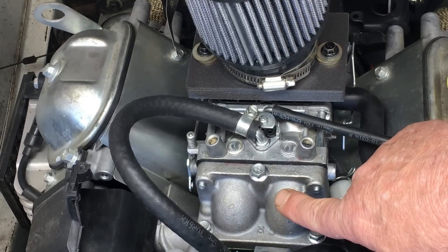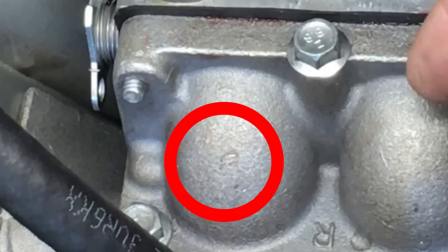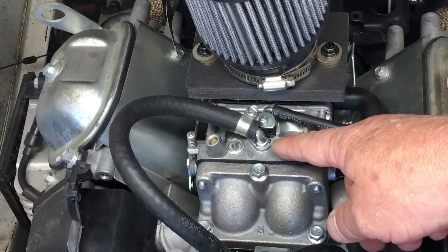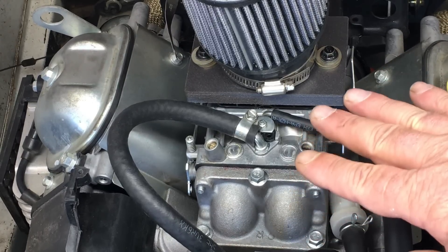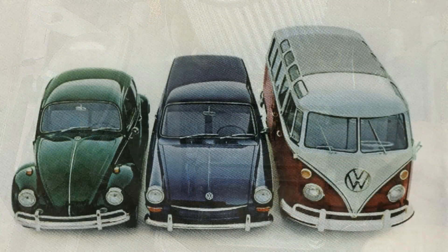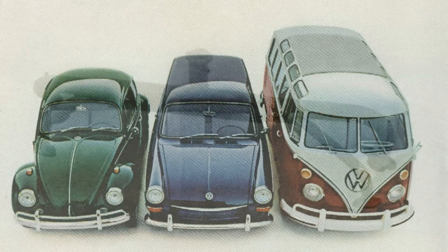One of the things I noticed about this carburetor setup is the upper intake manifold gets super cold when the engine is running. If we zoom in, we can actually see the remains of some condensation that formed on the manifold. The reason the upper intake manifold gets really cold is not a mystery at all — this is common with carburetors, and the short answer is it's due to the phase change when the gasoline goes from a liquid to a vapor. Generally cold is better, I would think, but back in the day Volkswagen found this phenomenon to be undesirable, and they had to route some of the hot exhaust next to the intake manifold to improve performance.